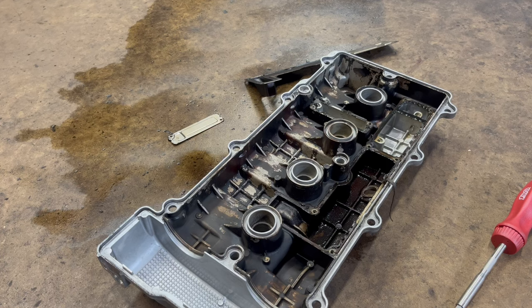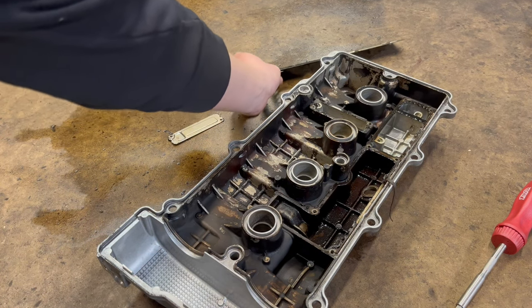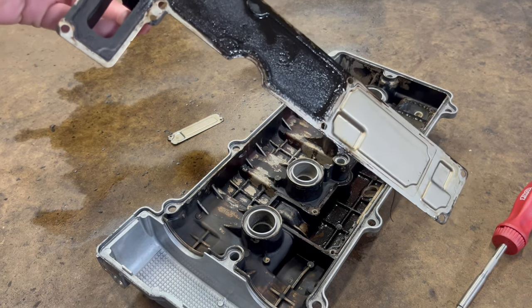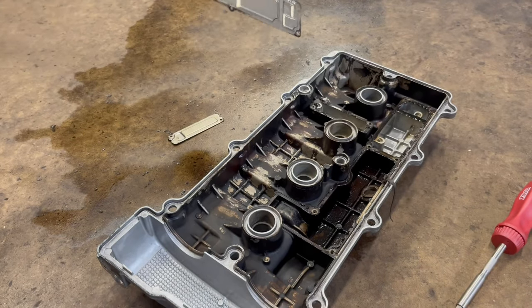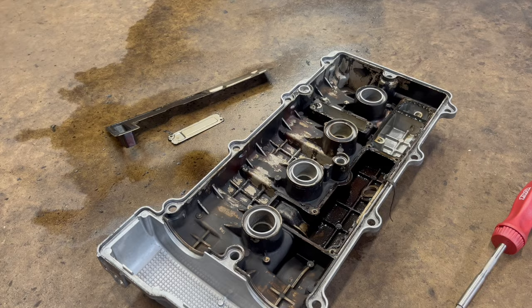All right, so I know at this point you guys are probably wondering why I washed this valve cover and did all that work just to pop more stuff off at the end. I didn't want to bend the metal — I had silicone sealer around it for the PCV system of this car. I put it in the parts washer and they came off nice and straight. I'm going to give these a quick scrubbing and reseal this up because that's going to be no good for the PCV system.